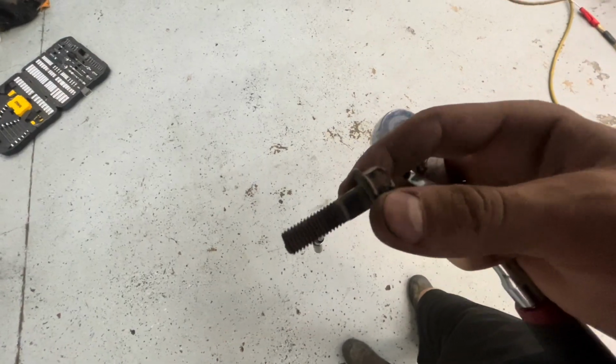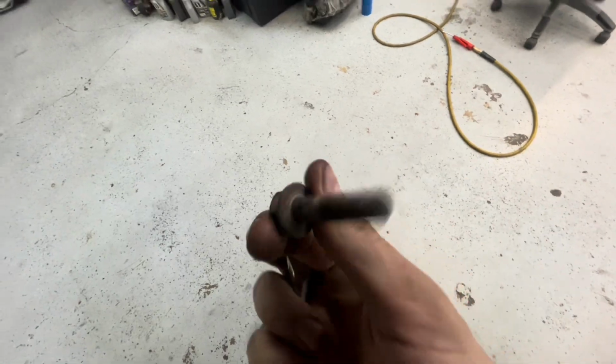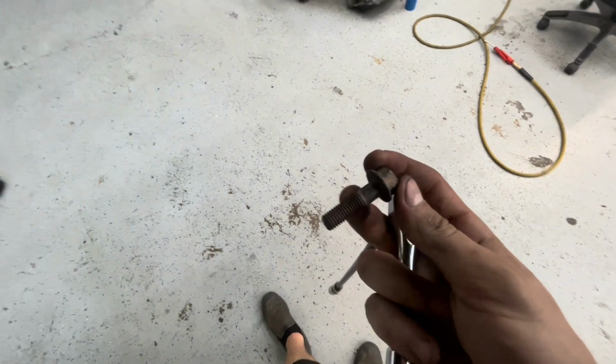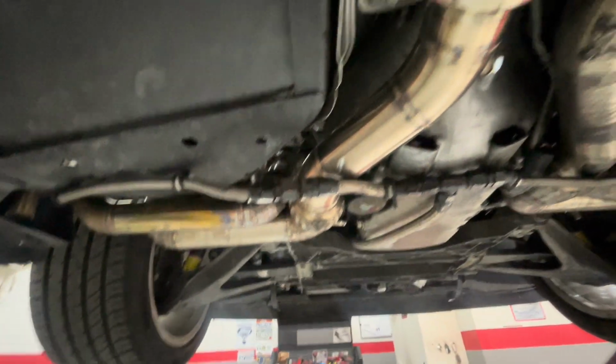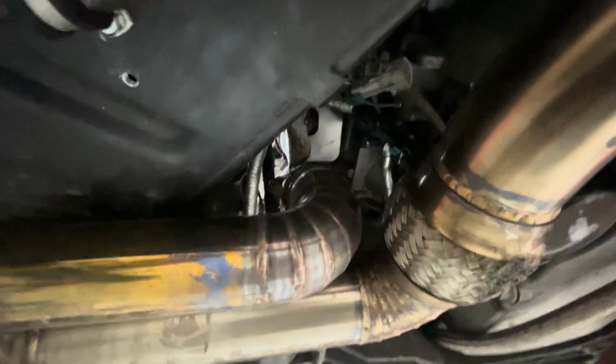So I'm noticing all these bolts, there's no Loctite, no nothing. It's just old bolt looking. But yeah, the second one on the flange completely loose. Literally, I think looser than the other one. So I'm gonna go around and double check all these bolts, clamps. Maybe the clamps might be all right, but all the bolts for sure. Check these 2 out, check the turbo out, just everything, so nothing becomes loose and more exhaust leaks. So yeah, I'm just gonna go through, tighten all the bolts up with this extension.